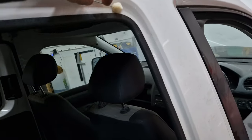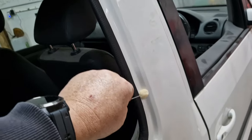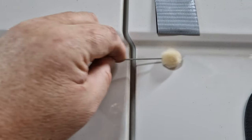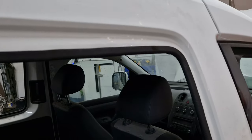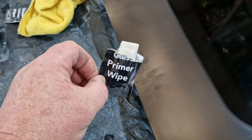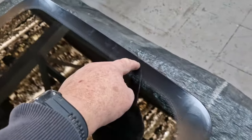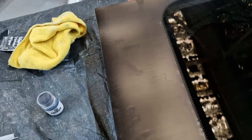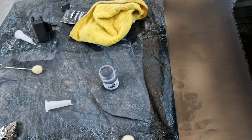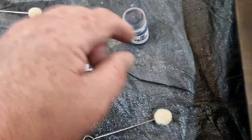With the primer applicator, just go around the edge with primer, going about to here. Then with the primer wipe — I think they're alcohol cloths — you can see where I've handled the glass; all of that has to come off. Go all the way around, then prime the glass, and put the glue on. I normally cut these nozzles down just that tiny little bit — it seems to give a better, nice pointed edge.